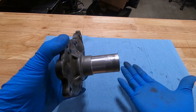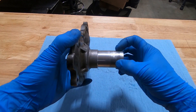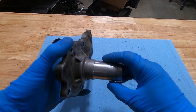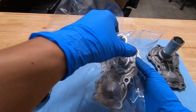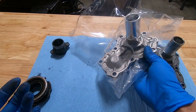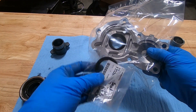If the grooves aren't too deep, I'll use a sponge with a piece of 600-grit sandpaper and go as evenly as possible, then clean it off and do 1500-grit. If you're feeling deep grooves, you probably need to replace the snout. This is a brand new unit from Subaru - it was about $80 and you'll probably need to special order it, which took about four days. Importantly, it already comes with a grease seal for the input shaft pre-installed, so you don't need to buy a separate one.